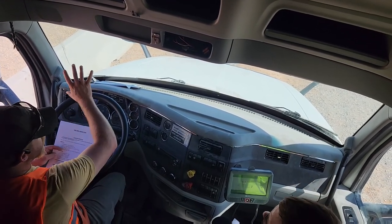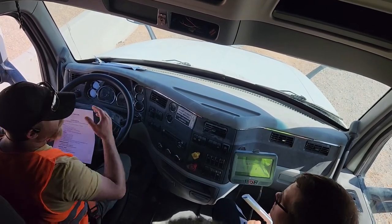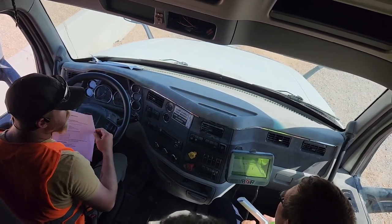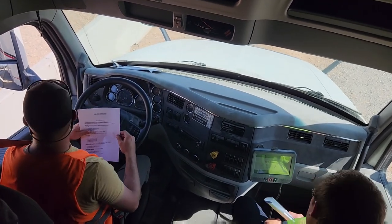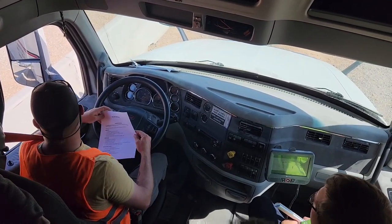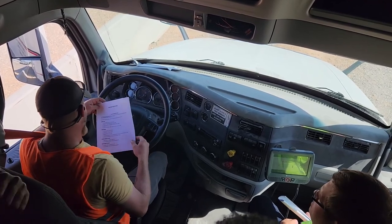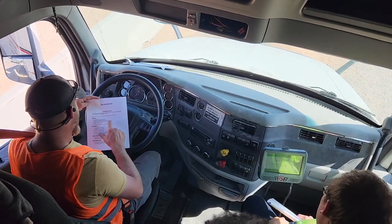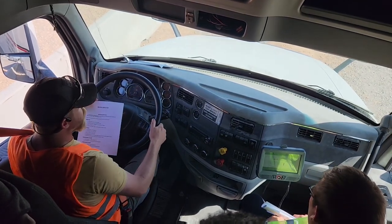You'll speak about your windshield. My windshield is not cracked or broken. It's clean, free of debris, is properly mounted and secured with no leaks. My windshield wipers are properly mounted and secured. The rubber is not torn or missing and they fit firmly to the windshield. My driver's side mirror and my passenger side mirror are both properly mounted and secured. They are clean of debris and they are properly adjusted to me. My steering wheel has no more than two inch play on a 20 inch wheel. Okay?